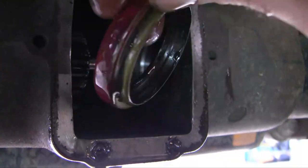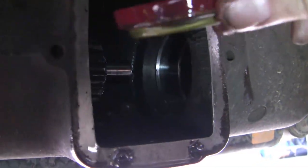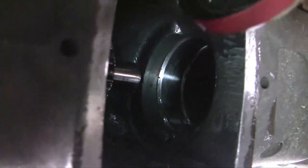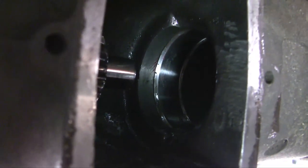Notice that we've got an oil pan below to catch the drippings because this is full of gear oil. Now the seal we're going to replace is right in here — you see it? Right there. So we're going to go in there and replace that seal. Here's the seal — I'll pull it out this way. That's the way it goes in: this side on the outside and this side on the inside. You can see there's a seat the seal fits into. One of the critical things is that you not pull it too far outside, because it'll crimp down on the axle and ruin the seal. You've got to pull it in just right and not too deep.